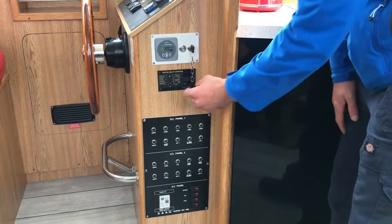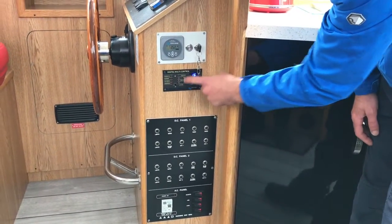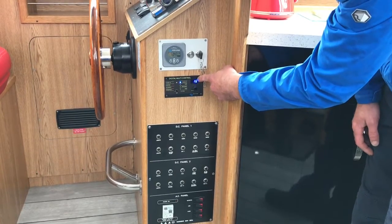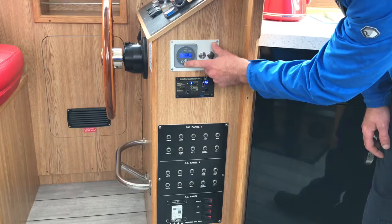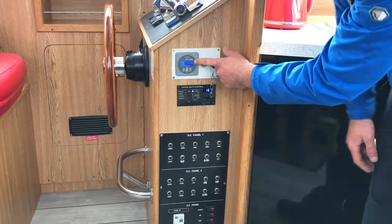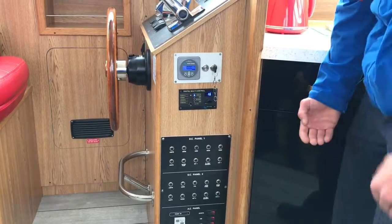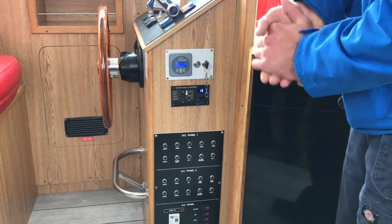Okay. So once you've connected your shore power lead, flick your multi-control into charger only. 16 amp current on there, and then you'll see your voltage start to climb on here. So ideally we want 100% battery before we unplug the next morning, and that will give us between 4 and 8 hours worth of running time on the motor, depending on how hard you ride it.